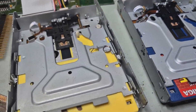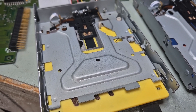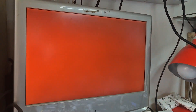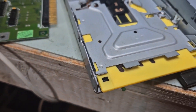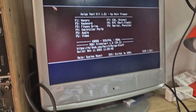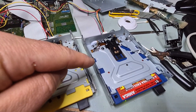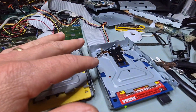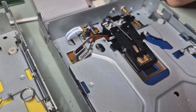You need to jumper switch three on those MPF Sony floppies. And if you don't, this is what happens — it seeks for a while and then typically you get a red screen. Now if I press this switch here — there you go, we're booting to Amiga test kit. So we're going to do the mod on this side. Same treatment on the third drive and we're now reading properly.